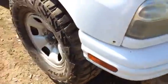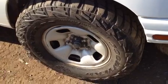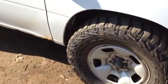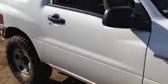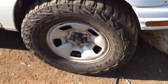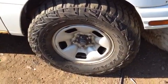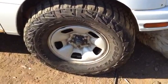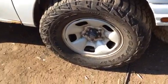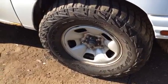The other upgrade I'm planning is manual locking hubs so I can freewheel the hubs and stop the front axles turning when in two-wheel drive. It's not strictly necessary since I only use it off-road occasionally, but it's a fun trailblazing vehicle. I've been told some older locking hubs will bolt right on — it's basically just a steel plate that locks the axle to the hub. When on easy trails I could leave it in two-wheel drive and disengage the axles.